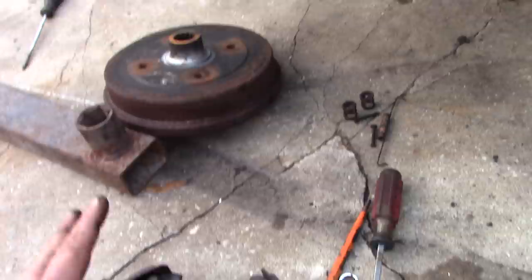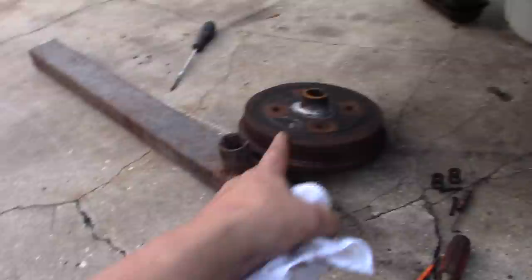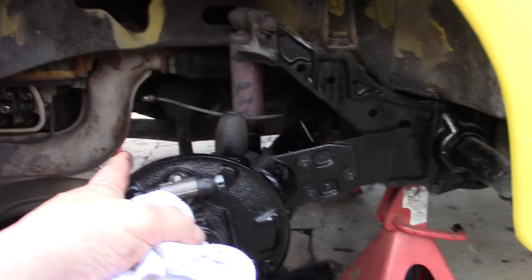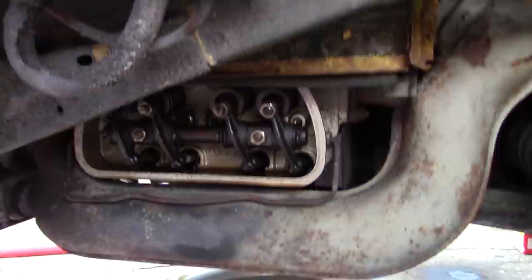The shoes have been contaminated with brake fluid so we're going to change those out with new ones. We'll get the drums painted up tomorrow, knock the rust off and paint those as well so they're protected. When you look through the wheel after a brake job you don't want to see a rusty drum. We have new shocks for the back and soft lines to put on — that's why the brake line isn't connected. I'll replace the soft lines and reattach the hard line.